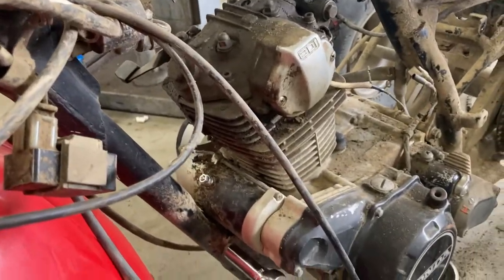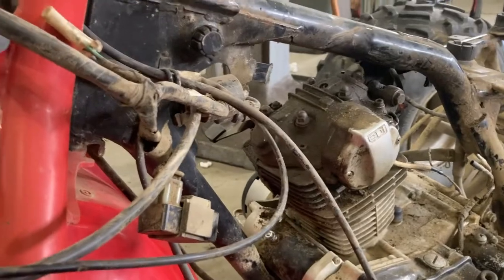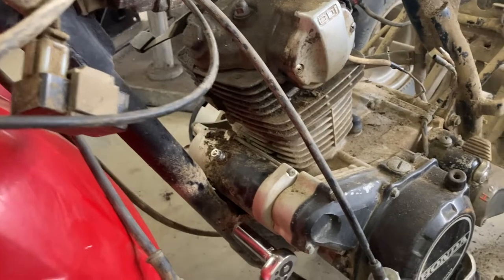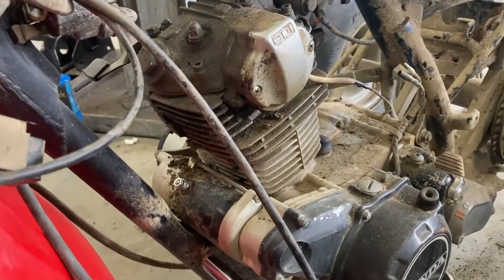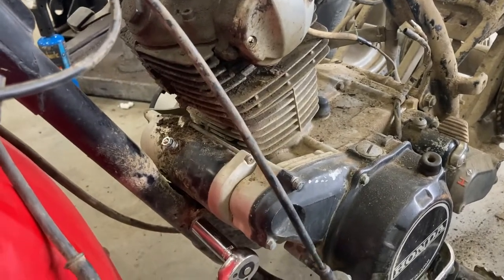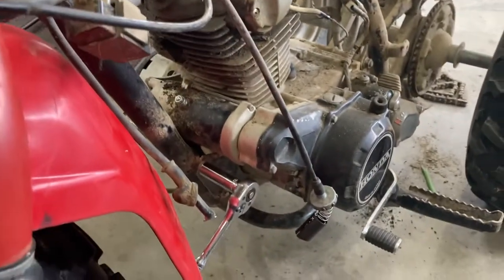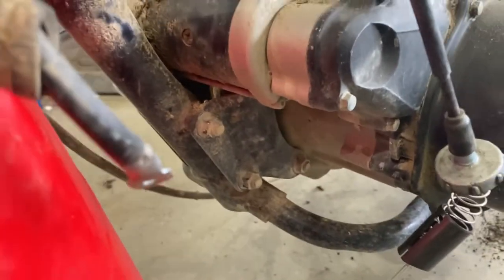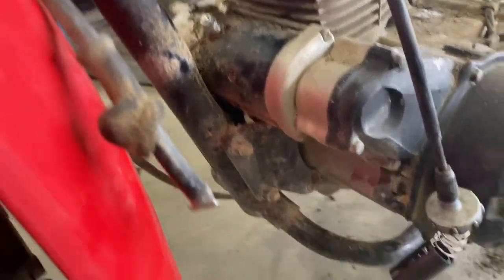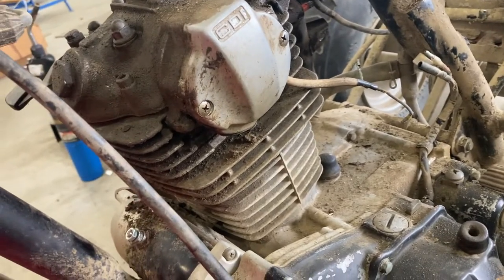Now getting to the final stage of pulling this engine and sub transmission out of the frame. Going through a lot in this video — ending it once the engine is out, then starting part two of the series: removing the head, taking the cylinder off, boring and honing it, splitting the cases, pulling the crank. Might be putting a mild performance cam in when it goes back together. To get the engine out, starting with the front mount — taking those out, taking the bar in the back out, and checking what else is holding it in. Going to loosen all the bolts then knock them all out.